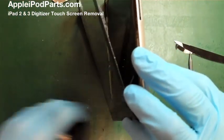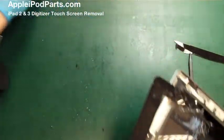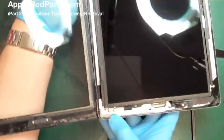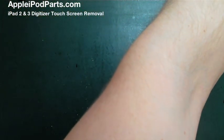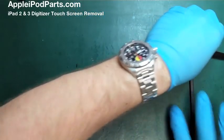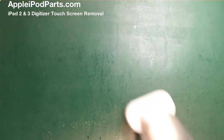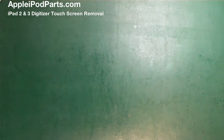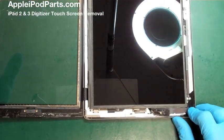And there you go — I've worked all the way around now to the point where it's come away from the screen. Always make sure you don't touch the LCD underneath because if there are shards of glass everywhere you don't want to be rubbing them into the LCD and scratching it. I like to use this little hoover to make sure everything's clean, because if you've got little shards of glass and you put the iPad down to do the rest of the job, the glass on the back is going to scratch against the back of the iPad.